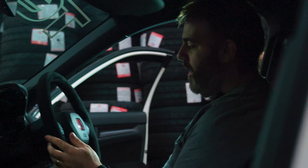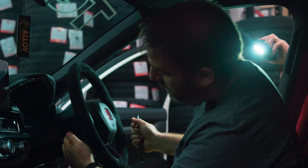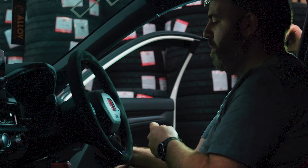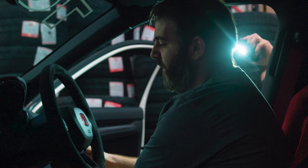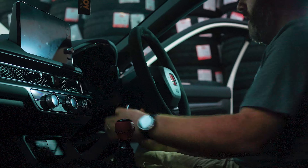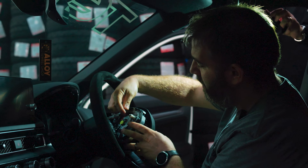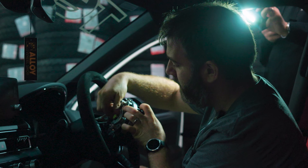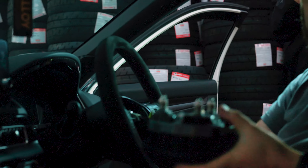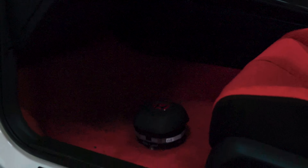Right, so now the battery's been disconnected a good while. We're going to remove the wheel. First thing we need to do is remove the airbag. On this one we have a small hole, another one on the right-hand side, and a third one underneath. I'm going to get a screwdriver and pop these off — it is quite fiddly. First thing we have is an earth strap — that's for the horn — and then we have the airbag connector here, so we'll whip this off.